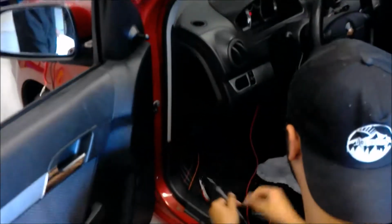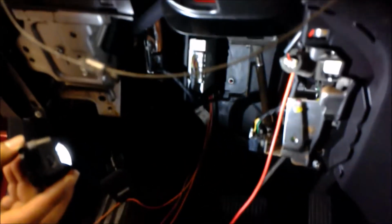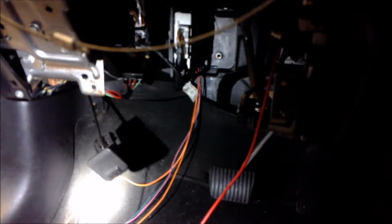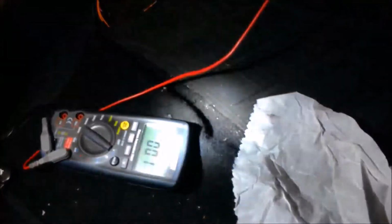Underneath, I've already found the wire and probed the wire. Got a good connection up there. I've probed the wire into the harness up here. It's got a good connection, and all I have to do is take my negative lead and probe it on a good ground, like this bolt right near the door. It should read less than 200 millivolts as well. It's at 0.1 millivolts right now. So essentially there's no high resistance in the circuit.